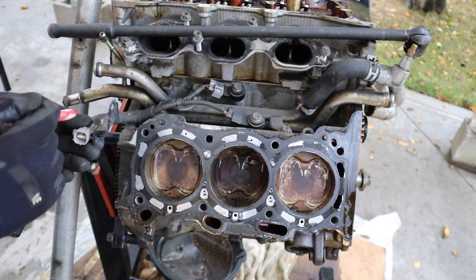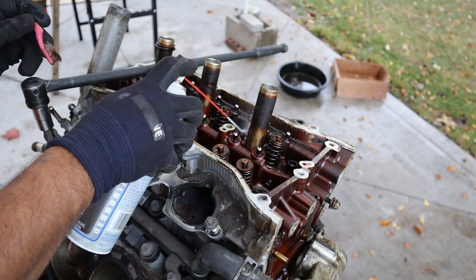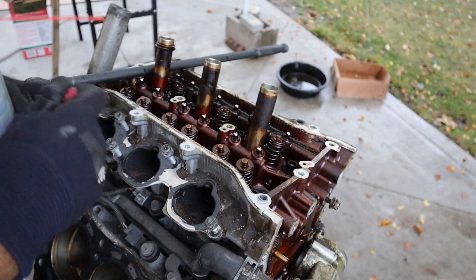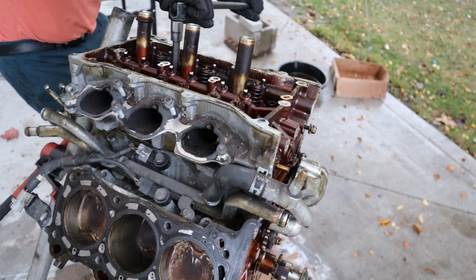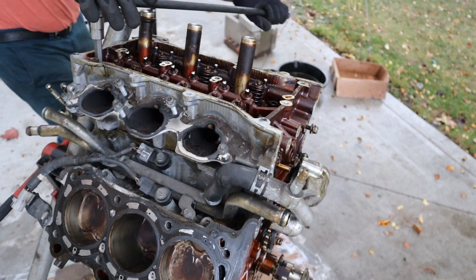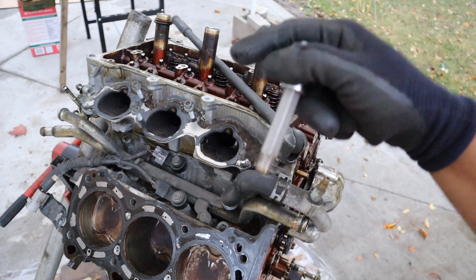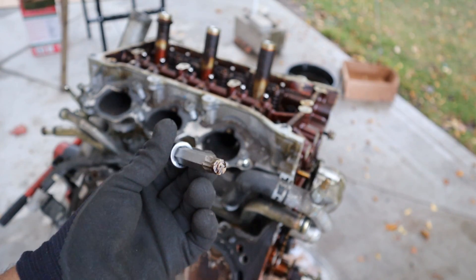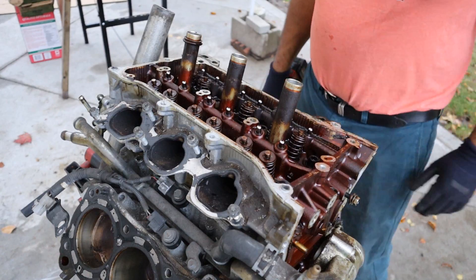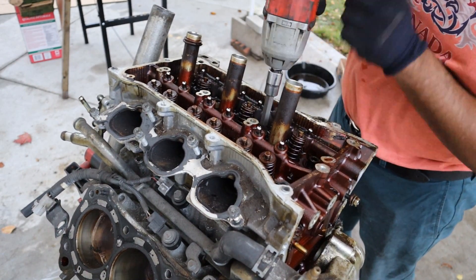Luckily they made part of the loom removable. Best way to clean your head bolts: a little bit of brake cleaner and a toothbrush. The bi-hexagon socket is awesome, especially if you work on a lot of Toyotas — I'll leave an Amazon link in the description. This is different from an M12 triple square socket because of the shape of the points. Now even on the front bank the compression wasn't very consistent, so let's see if we see anything underneath.